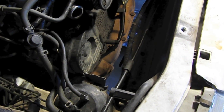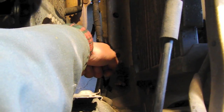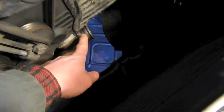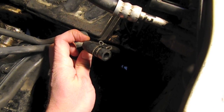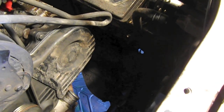First thing I did was drain the radiator. The radiator is already out, but there's a drain plug that sits right about here — just a little thumb screw. Pull that out and drain it into a pan. Then you can remove the upper radiator hose and the lower radiator hose to get all of the coolant out. Since this is an automatic transmission Subaru, it has two lines for the transmission cooler. The cooler actually sits in the radiator, so you just disconnect those and drain them into a separate container for recycling at the auto parts store.